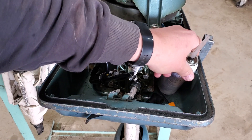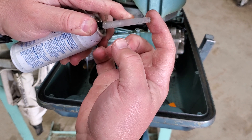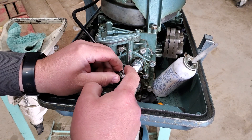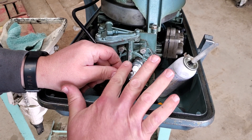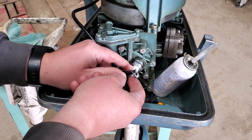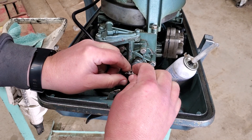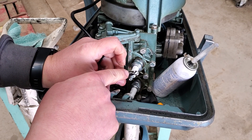Now I'll take a little more dielectric grease and put some on the end of the wire and around where the spike went through the side. Then take and roll this thing over on the end so it contacts the spring terminal at the end, and this is going into the core.